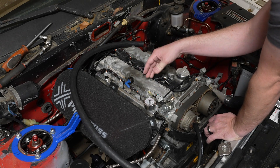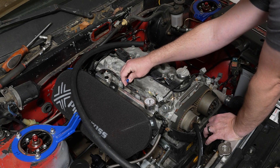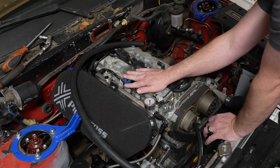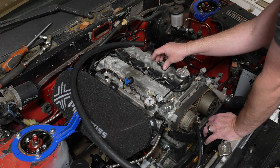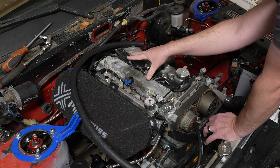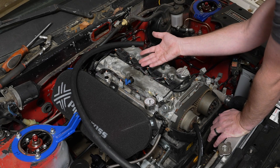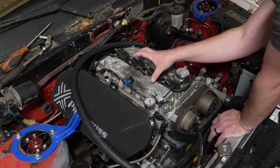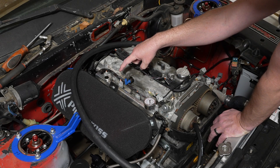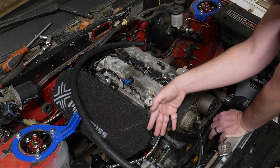The way the PCV system works is that under high or medium vacuum situations — like at cruise or at idle — this PCV valve is hooked up to the intake manifold, which would normally be here. This goes straight to the intake manifold, so there's vacuum being pulled on it. This vent on the other side has some baffling but doesn't have anything to restrict flow if a vacuum is pulled here. Essentially at idle and cruise, we're pulling a vacuum and siphoning off crankcase gases and oil vapors. As we siphon it off, we have to replace that air with something — that comes from your fresh air vent. So the stock setup has this blue PCV valve hooked to the intake manifold, and this hose comes out to the stock intake after the mass airflow sensor.